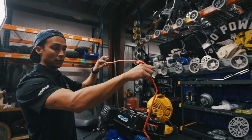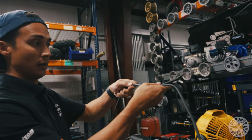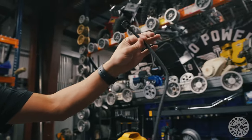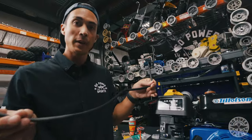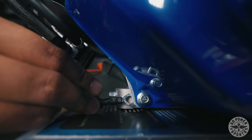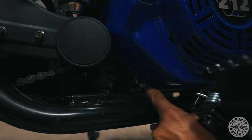You've extended your positive post and that's connected to your battery. Now you can do one of two things: you can extend your negative post to reach all the way back to your battery behind your engine, or you can take it off of your engine by undoing it behind your starter and taking it completely off. Then connect it behind the bolt up against your block and the other end to your battery — which is exactly what we've done on this bike, connecting it all the way to the battery and down to the bolt up against your block.